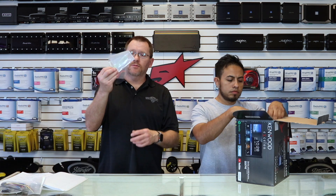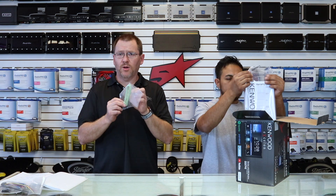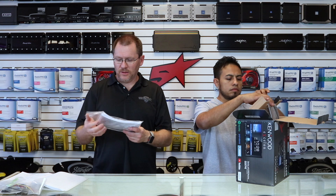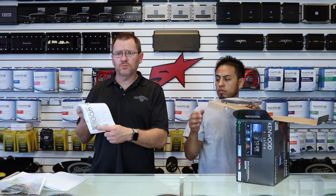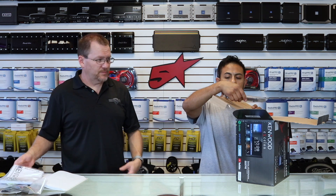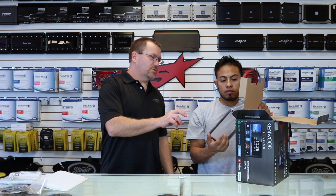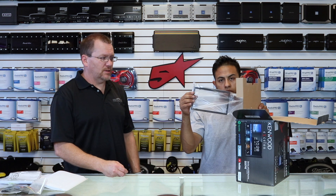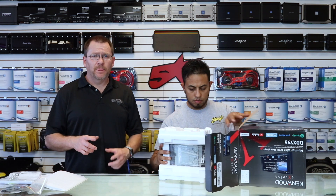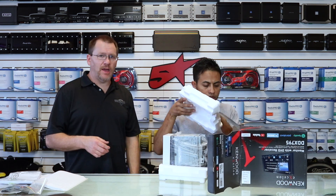They give you an extension for the emergency brake wire. It comes with owner's manuals, a warranty card, a bag of screws, and some extraction tools — they still give you a cage in the box. It comes with a trim ring if you're going to use the cage. On some European radio dash kits the cage is a little too big, so beware of that.